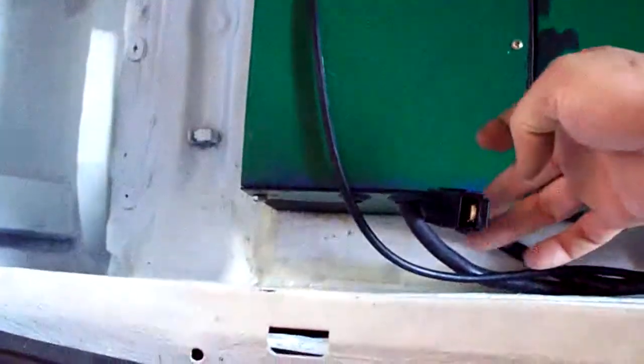So this is the progress up to now. 90% of the BMS wires are all in. Next, I would not make the high power cable connections yet, as you can see the high power connections are not made at all, not until the very last minute. I'm not going to connect them. I've made only 1 connection out of maybe all the 5, so I'm leaving the high power connections by themselves for now. So that's the progress for now.